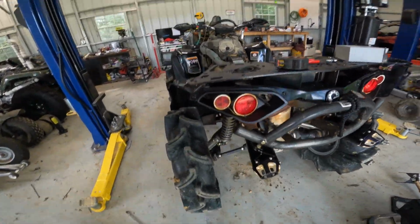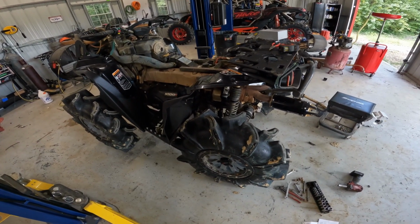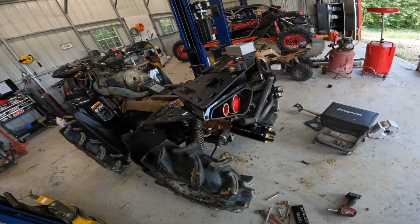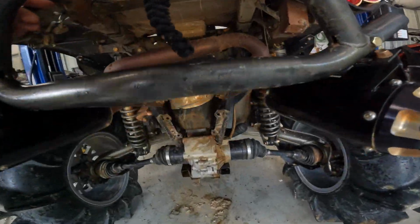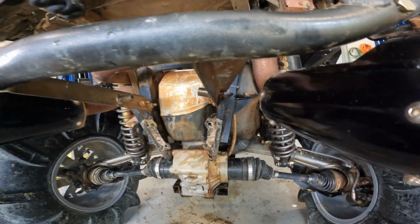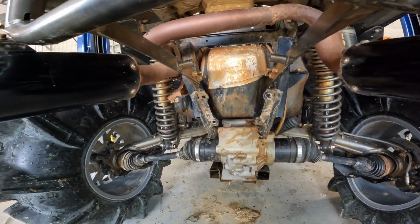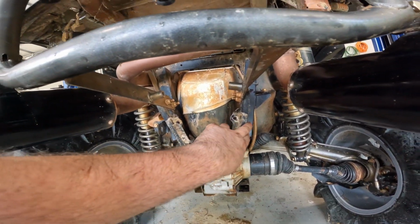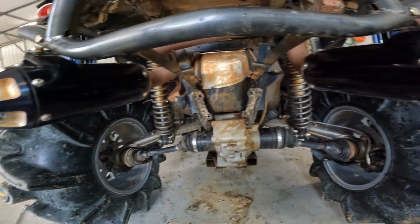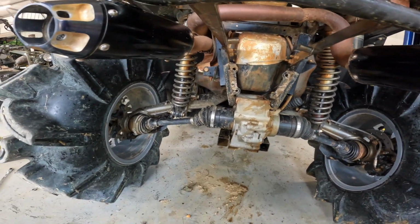Yeah, I'm just looking at this and checking the space. I'm going to go ahead and just pull off these rear tires, pull off the rear control arms. My buddy claims that you can take this brace off here. That's got some mountings on the fuel tank and back and encapsulated bolts. And you know, honestly, I think it's going to be more work trying to get this brace off than just going ahead and popping the control arms off on either side. So I'm going to go ahead and get it in the air, get these back wheels off, and then we'll show you what to do next.